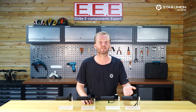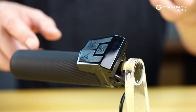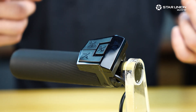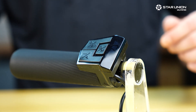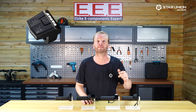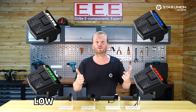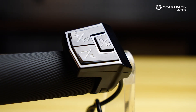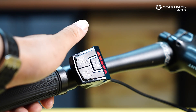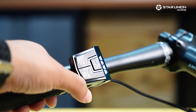For the ultimate in functional design, we would like to present the DZ39. In this HMI, the display takes a backseat to the remote function. The display comprises five multicolored red, green, blue LEDs to communicate the most important information only: battery level and motor assistance. The number of lit LEDs communicates the battery level, while the colour represents the assist level — from zero shown by white, through green, blue and red to represent assistance level low, medium, and high respectively. The HMI utilises sturdy ABS and polycarbonate plastics, while the window is high hardness brushed polycarbonate for improved visibility in all light conditions. The HMI is weather resistant and exceeds IP65 for use in all weather, rain or snow.